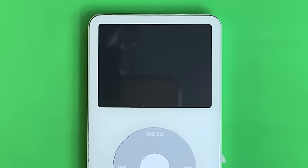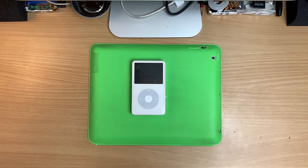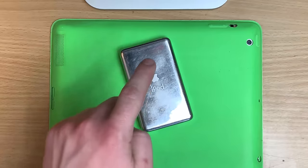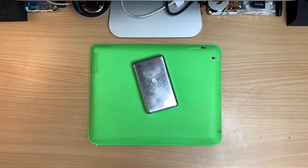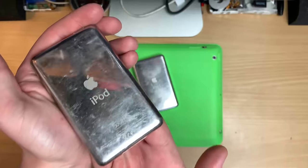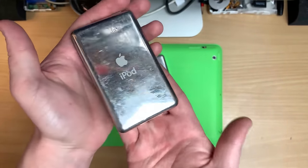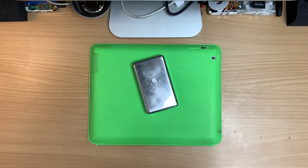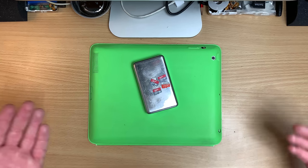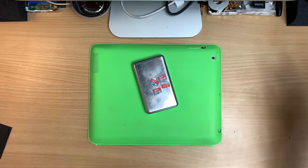Can't wait to see that screen running. So why is this one so good? Well, people agree that the 5th gen is the best sounding iPod, funny enough. But also because it's got that 80GB in it, it's got more RAM, meaning we can do more with it. I've put 256GB into one of these 30GB iPods and it just freaked out — it would crash and all that sort of stuff. 128 runs really nice on this. I've seen people get a terabyte into these, so let's do it. I want to see if it works — I don't think so.